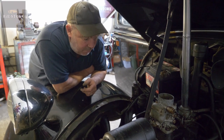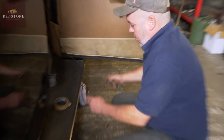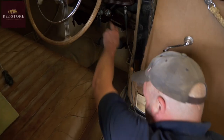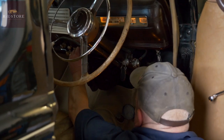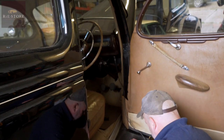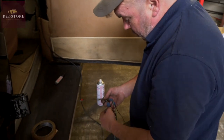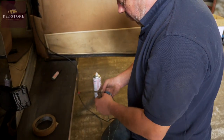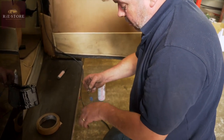It's exactly the same dimensions, same CC — 3.6 litre. I'm just trying to work out what wires they've got there. That one should go on and off with the ignition, which it does. That one should go on and off with your side lamps, which it does. The other one should give a dull reading on ignition — that's your petrol gauge feed. Now I've got to rewire it all. It's the old stuff — not plastic coated, it's bitumen with cotton over it. It'll just snap. You can't leave it all like that.